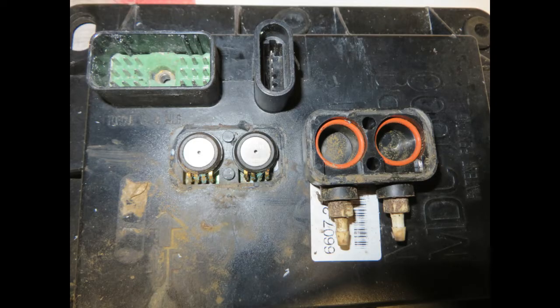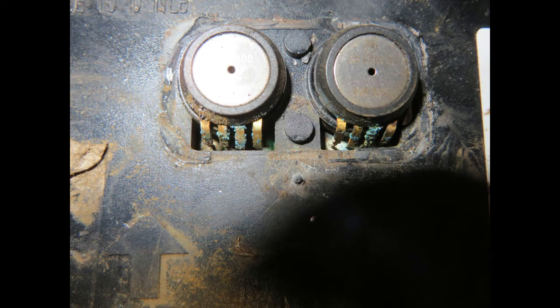This MDC, when it arrived here, the plastic dome had already been broken off — freeze damage I'm assuming — completely breaking the seal where the dome was attached to the housing. Water has obviously gotten into the circuit board. You'll see in this picture a close-up of the actual contact of the pins from the sensor and the corrosion that's already taking place.